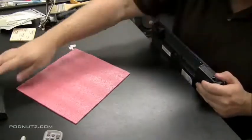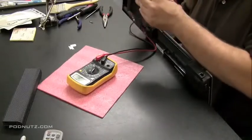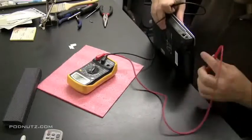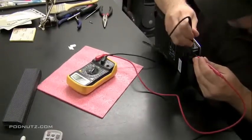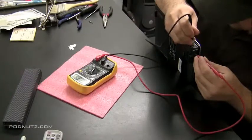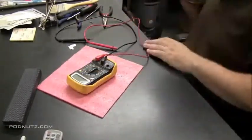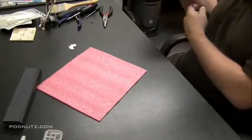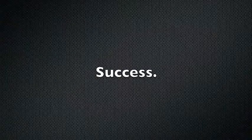We're going to test the work we did with a voltmeter — make sure there are no short circuits. I'm going to set the meter to test for continuity and put the positive lead right in the power jack on the post in the middle. We're going to attach the other connector to a ground point on the laptop. If we touch that center post of the power jack and a ground point and we're getting a beep from the voltmeter, we know there's a short circuit. If there's no beep, that means your ground points aren't touching your positive point — and that's what you want. I like to test that before I plug the power adapter in, because I don't want to fry anything. Unfortunately I ran out of tape at the end of this repair — the last thing we needed to do was put the battery in and we were good to go. Everything tested out okay, the laptop powered on, and everything worked. So that is a done repair.